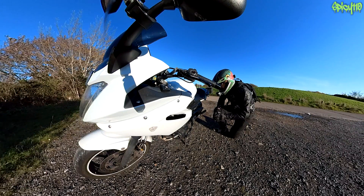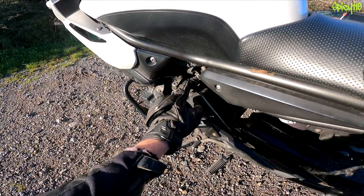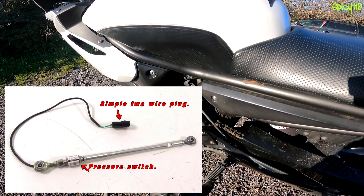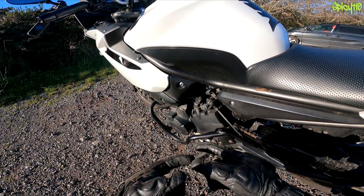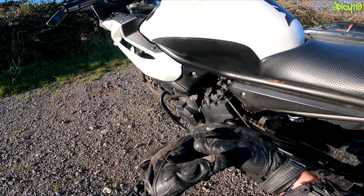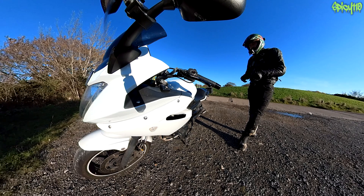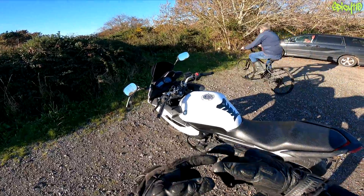So how do quick shifters work? This is either factory installed on your bike or you can buy kits to fit it to any bike, because it's actually a very simple thing. Here you have a bar that is part of the linkage for the gear shift — this is actually where the gear shift is, and as you can see the whole thing moves. If you put a pressure switch in this rod — replacing this rod with another rod that has a pressure switch in it — when you go to change gear, it notices that. It has a wire that goes up into the loom, and when it gets actuated it cuts the spark of the engine, relieving power from the gearbox for a moment. This gives the gearbox a moment to relax and lets those teeth connect more smoothly in that float point. If they're still under power they're just going to smack into each other, round off the edges, and it means the bike can slip out of gear. So if you don't want to use the clutch, you can let off the throttle for a moment, or you can have a quick shifter that cuts the ignition for a split moment while you change gear — relieving pressure on the gearbox the same way the clutch does.